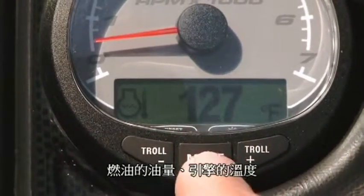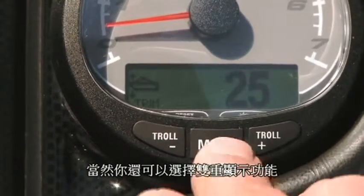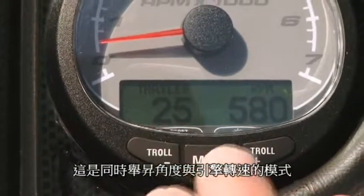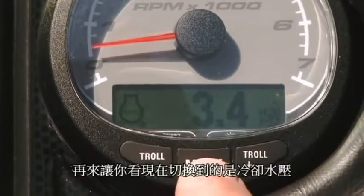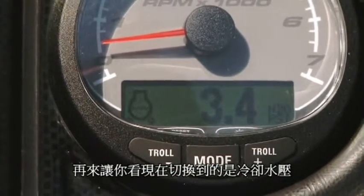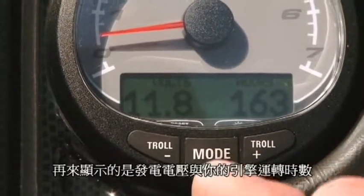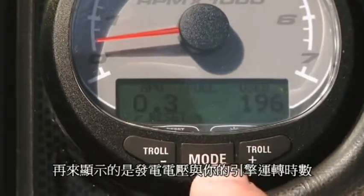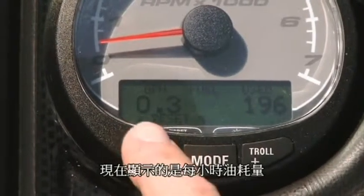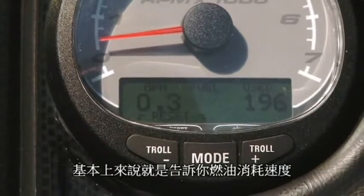The gas gauge comes in, temperature on your motor, and of course you get a lot of double gauges — right here you've got trailer which is your trim and your RPMs. This one right here is your water pressure. Water pressure is extremely important for keeping your engine from overheating. And then right here you've got your volts again and your hours. That little thing says gallons per hour — basically that's your fuel efficiency.